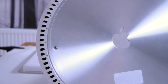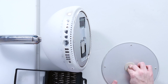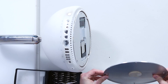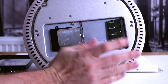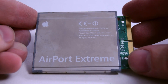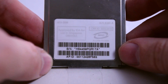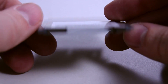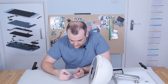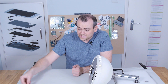The first thing I'll comment on is the quality of the base. Considering this is what it stands on and you're supposed to never see it, this thing's gorgeous. Wi-Fi on this was an option you could have fitted at the factory, or added as an optional extra. This is definitely an Apple product, but the form factor looks like a PC card or PCMCIA card — the big slots you used to have on laptops for accessories. I don't recognise that pin connector along the edge, so I think this must be a bespoke Apple card. It'd be interesting to know what actual Wi-Fi chip is on board, because that is undoubtedly going to be an off-the-shelf part.